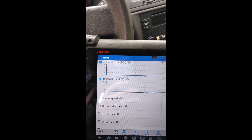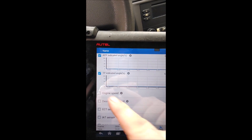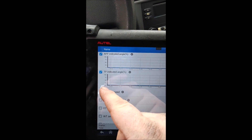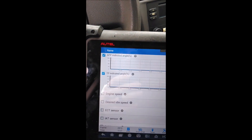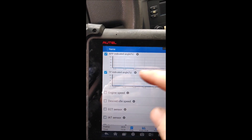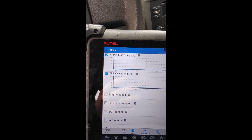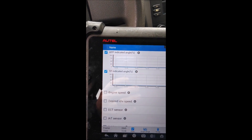I'm on a road call with this 2005 Cobalt. What I've got pulled up here is the accelerator pedal position and the throttle position angles. What was going on with this car was these two were getting out of sync and causing it to go in power-reduced mode, which if you have a GM, you know you can barely drive the car when it gets like that.